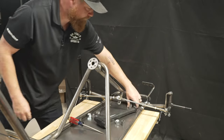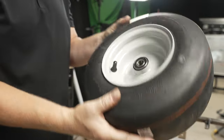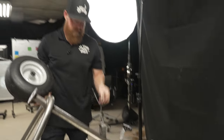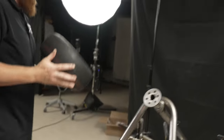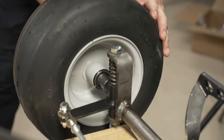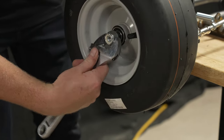Let's slap the tires on. These are offset — you have a shoulder coming off the back and it's a lot shorter on this side, so that's going to space your tire out. The spacer goes on first. You'll have to use a crescent wrench — that's fine, that's what most people are going to be using because they don't have a big socket set.